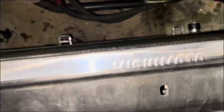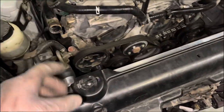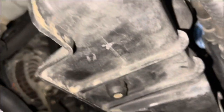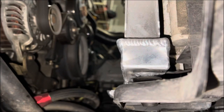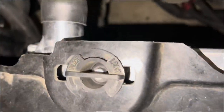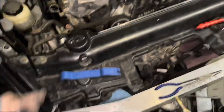The radiator is installed — as you can see it says Mishimoto right here. It's a pretty straightforward process. There are little slots on the bottom; I used the rubber grommets from the OEM radiator and put them on the Mishimoto radiator, then inserted the pins on the bottom. The AC condenser sits on the radiator and the radiator sits on the radiator support. On the top there are also little rubber grommets from the OEM radiator that you just slide on.